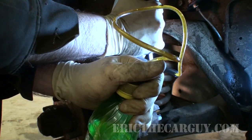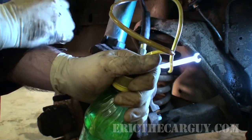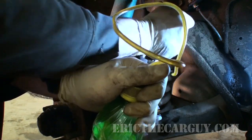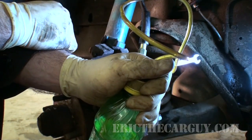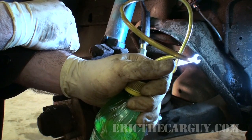Okay, and you can see the air coming out there, and it's not moving anymore, so I'm going to close the bleeder. Okay, pump it up 5 times. All right, hold it. Close it off again. All right, 5 times. Hold it.